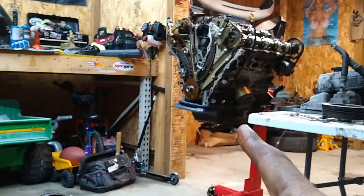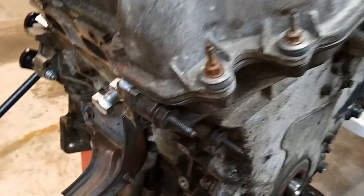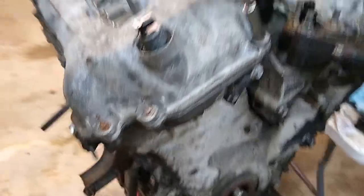I'm obviously not gonna mess with those, but the new cam sensors will come with that timing cover. So now basically we're just gonna switch over the reluctor wheel like I said, and then peel out the old gasket, clean this up in good shape, and slap it on over there.